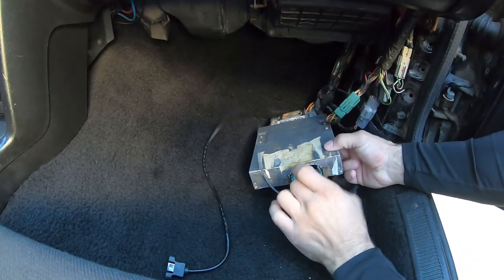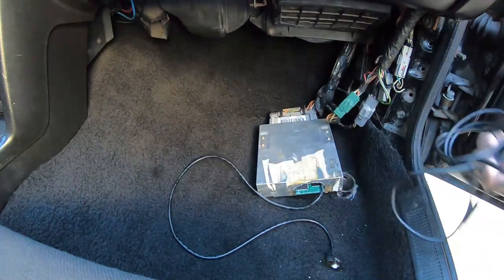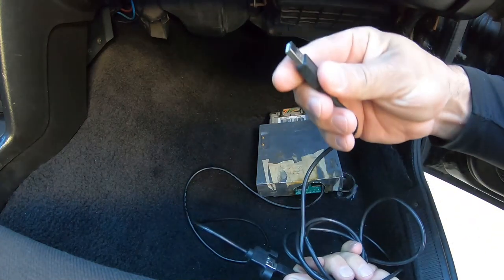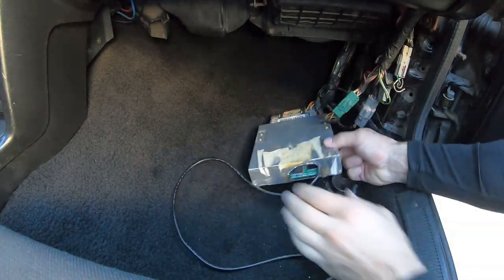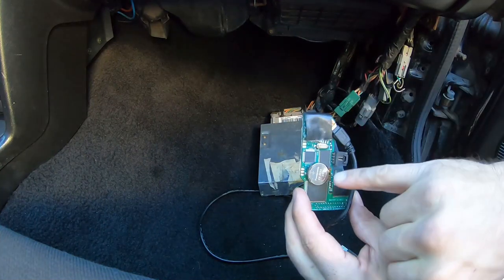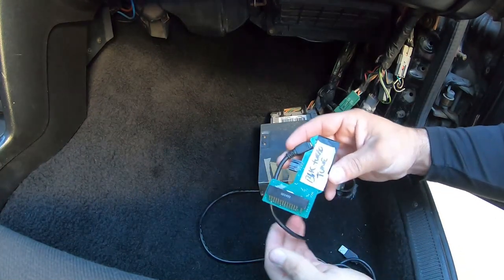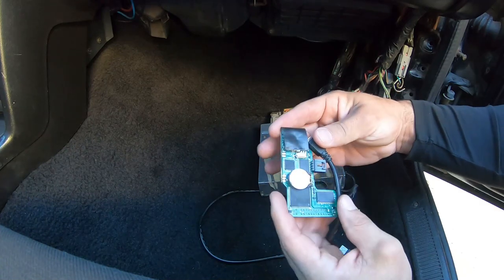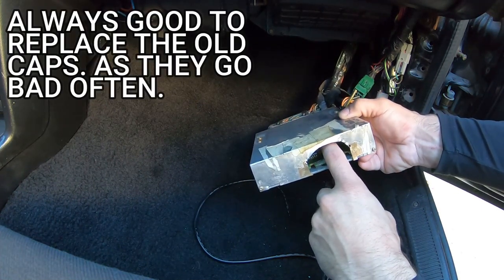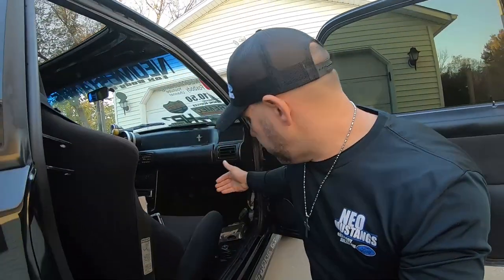In this J-port you can pull the chip in and out. It has a USB cord that allows me to connect to my laptop — here's the extension cable that makes that work. I plug this in and voila, it plugs into my laptop, easy peasy. This chip goes into the back of your A9L. It's got a little battery on it, so be careful because your tune will die when that battery dies — but that's very uncommon. Quarter Horse chips are long, shaped like an L. When you modify the case you have to lay down the two capacitors inside.